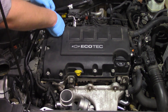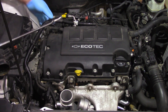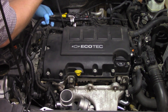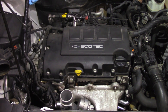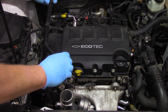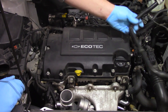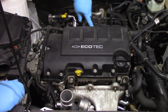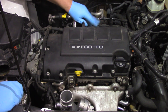There's one other vacuum hose connected down to the lower side of the intake, so again I'll use my longer tool to help pop that out of the way — and there we've got our old one out. Now we can see inside here we can see the one check valve, and then we also want to inspect the other check valve down inside of the intake here to make sure that it's okay.